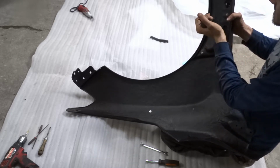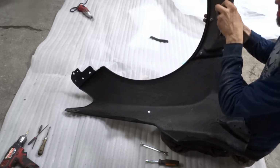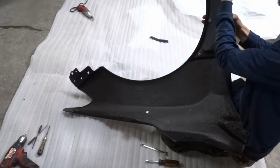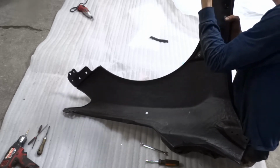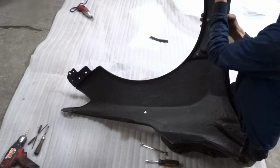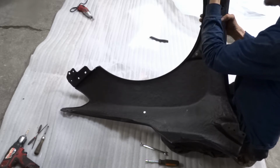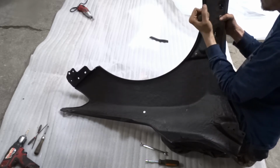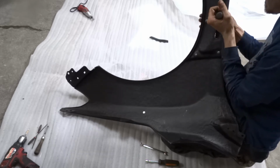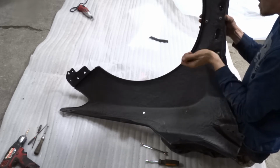but they are just epoxied into the carbon, so you don't want to go hog wild and tighten it real tight, otherwise you will crack your carbon or pull the stud out of the epoxy, and it's no longer going to do its job. But you don't want them on there so loose that they end up coming off driving on the road.